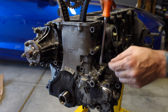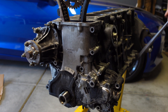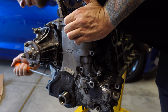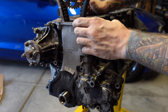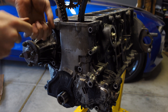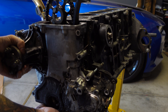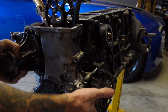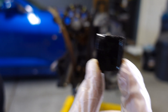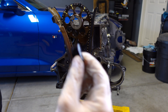There's little slots in the timing cover for prying right here — at least that's what they look like. All the bolts look like they're loose. There's another little slot over here for prying. There was one more bolt hiding right there — I knew I missed something. This is exactly why I never force things off. We got a little bit of the timing chain guide that fell out from behind that cover. I was wondering if we'd find that. It's probably been sitting there for the last 30,000 miles or so.